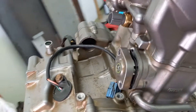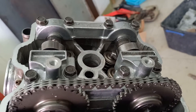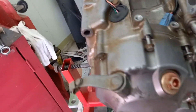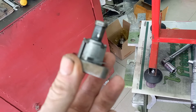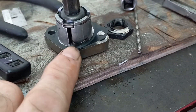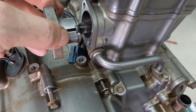Still plugging away and it's tensioner time. Now we've got the valve train built up, we need to spin the engine over and check the valve clearances. In order to do that we have to put the tensioner back in. Let's just dispel some myths about the tensioner — it's self-adjusting. There's a coil spring in the back of there, you can just see the tang there. The coil spring allows that plunger to come out on a ratchet as the chain wears.